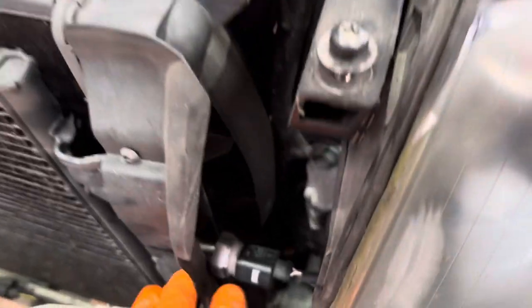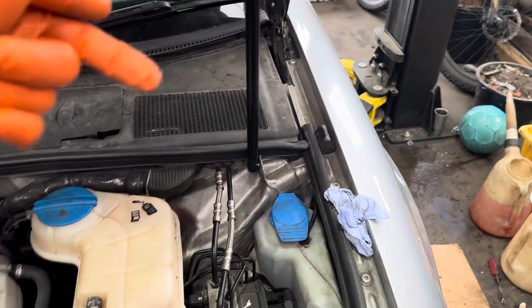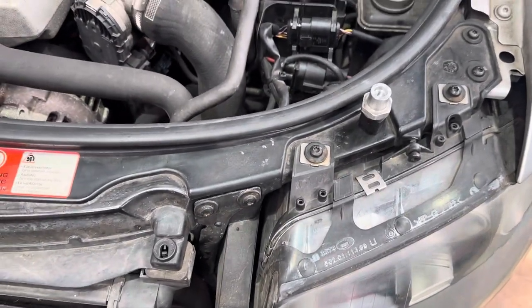Started testing the wiring, thinking maybe there's a break in the wiring somewhere. From the sensor this runs around the back of the radiator and comes up to this multi-plug here, then runs through the wing into the fuse box in the car. Everything tested out okay, so we were beginning to wonder what's going on.